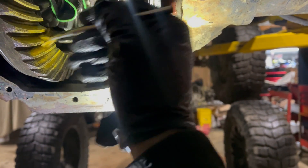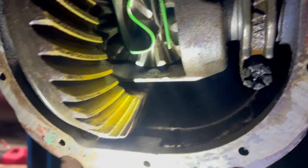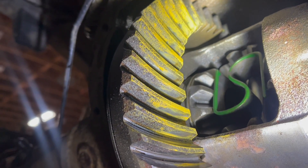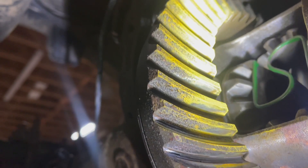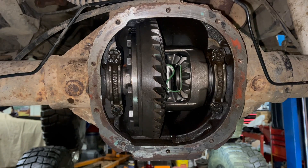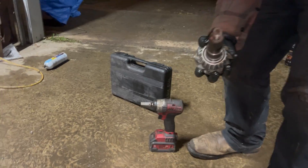Time to do the pattern check. I usually skip this step, and given that the shims and lash ended up absolutely perfect, I could just roll it off the factory floor. We probably don't need to do this, but we'll do it anyway for your entertainment. You take the little paste from the rebuild kit and paint it on the gears, then spin the pinion all the way around one direction, trying not to knock it around in the lash, and then spin it back. Here's our drive side pattern — it's terrible, but it does happen to be on the shiny spots next to the rust, which makes sense. And here's some transferred paint showing the contact pattern on the backside.